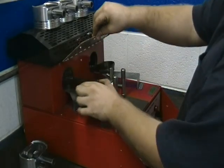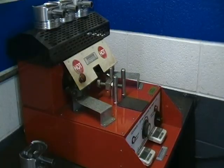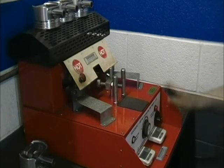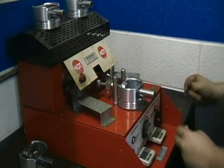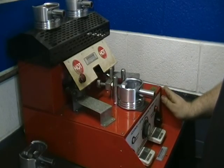Now we let some time stagger and put the other one in there — about a minute and a half to two minutes, just so you're not pressed for time when doing them. Keep the pistons on top there to keep them warm so that it makes the connecting rod slide through easier.